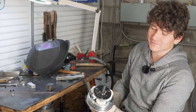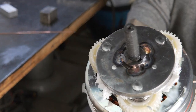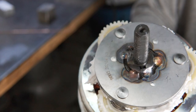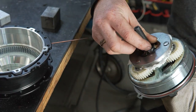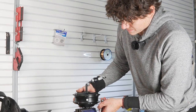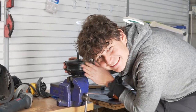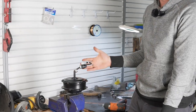Not the prettiest thing in the world, but I did a series of tack welds around the perimeter. I didn't let the heat dwell too long in any one spot, because that would burn up and vaporize all the grease and oils inside the clutch and risk damaging plastic or other materials. This looks functional. We'll wait for it to cool, slip the o-ring back over the axle, reassemble the motor, and make sure everything spins freely with no distortion. Nothing scraping, nothing ticking — this is spinning smooth as can be, forwards and backwards, no freewheel, plenty of regen.